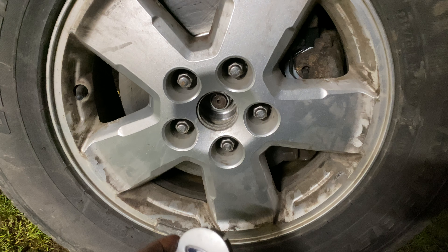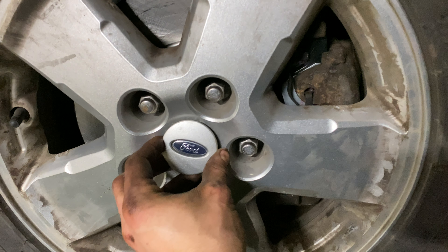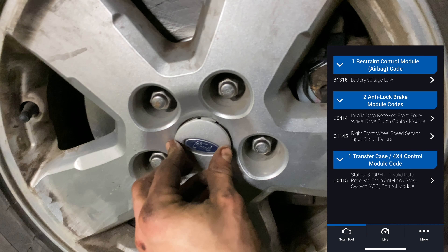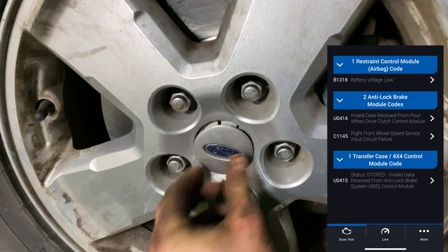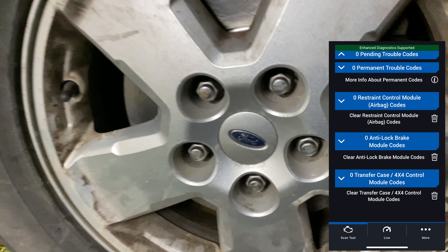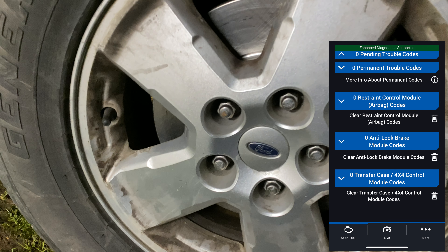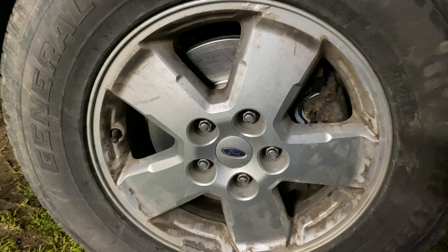Start the vehicle and pump the brake several times while still in park until the pedal becomes stiff. Initially there will be significant travel in the pedal — please do this prior to shifting the vehicle into drive. Last but not least, reinstall the axle nut cover on the wheel rim. Now is the time to get the vehicle professionally realigned. It's important to also mention that because I replaced the ABS sensors and the vehicle was not run for several days, I needed to clear some false positive diagnostic codes using my BlueDriver OBD2 Reader — but only do this if you know what you're doing. Having a reader on hand could at least let you know what might be wrong should a dash light appear. That's it! Thanks for watching — if you liked it, give it a thumbs up and consider subscribing.